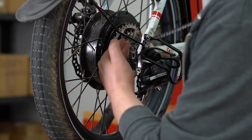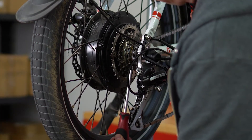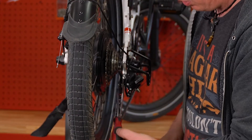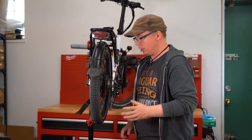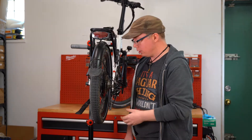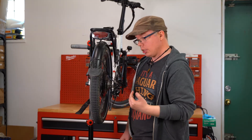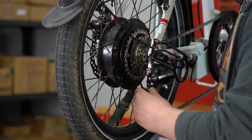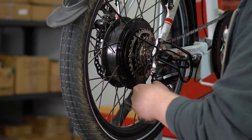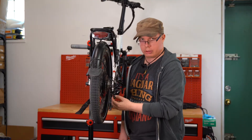The first thing you want to look for is to see how lined up everything is. If you can see here, if those are in a nice perfect line between all three gears, that's where you want it. This one here is currently set up to be correct — I had to shift this to put it out of placement. To shift it in towards the bike, you'll want to turn the barrel nut counterclockwise. To shift out, you'll want to turn the barrel nut clockwise.